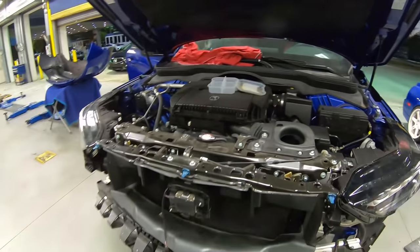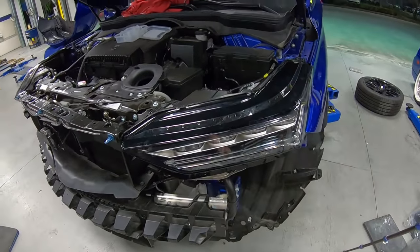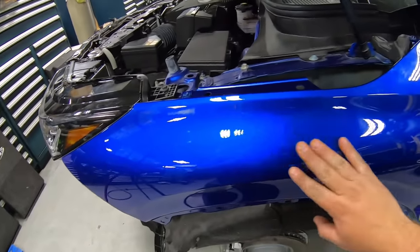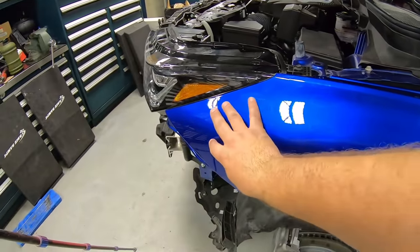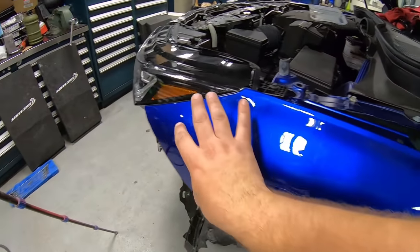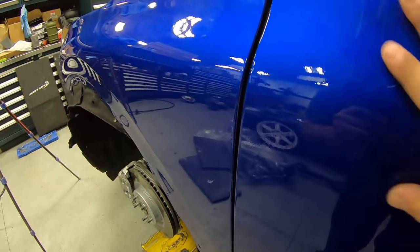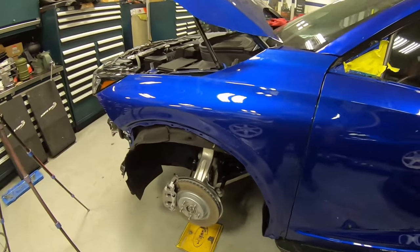All right, so we're good to go. We've got our two headlights installed. One of the beams we're waiting on is right there — I think we can still pop it in. I did do my test fit, but it's crazy how things change. I might even pull the headlight out because I want to give this a little rubdown. I've got maybe one or two little nibs. What I like to do is go over it with 2,000-grit very lightly, because I do not want to remove the peel. I'll do the top areas and carry it a little bit into the door. That's pretty much OEM texture, so I'm not going to go too aggressive — I don't want to give a dead giveaway that this has been resprayed.